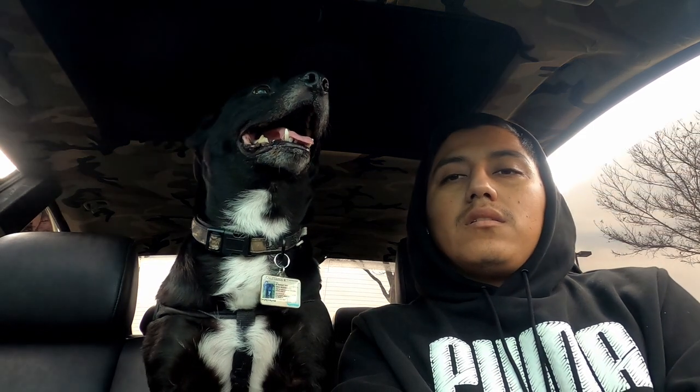All right, so the reason why I sold the wheels, just like I mentioned in the first video, I was driving a couple good miles out there, and what I was trying to do is make sure my wheels were getting cambered from inside. Now my wheels were 18s by 10.5. The downside is that on the front, because they were too wide, the offset was 35, I believe. It was between 25 or 35, the offset.